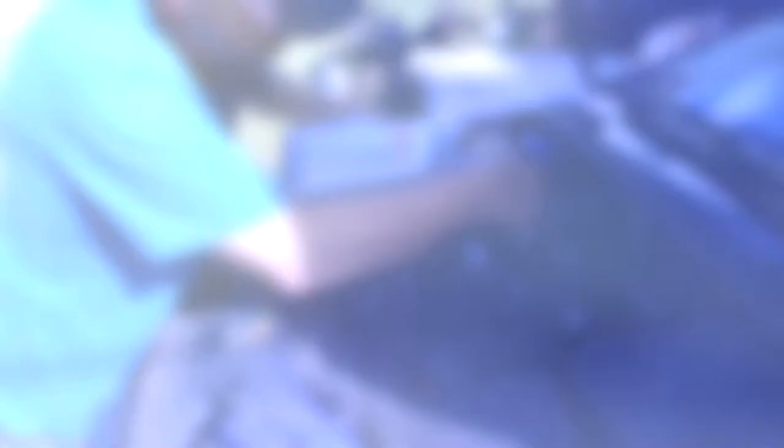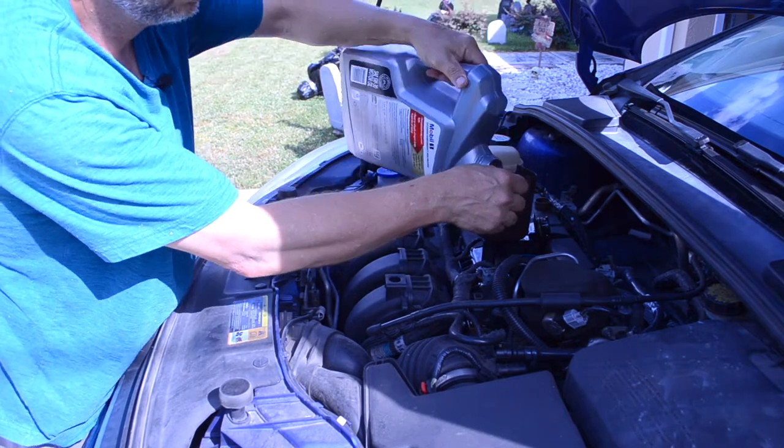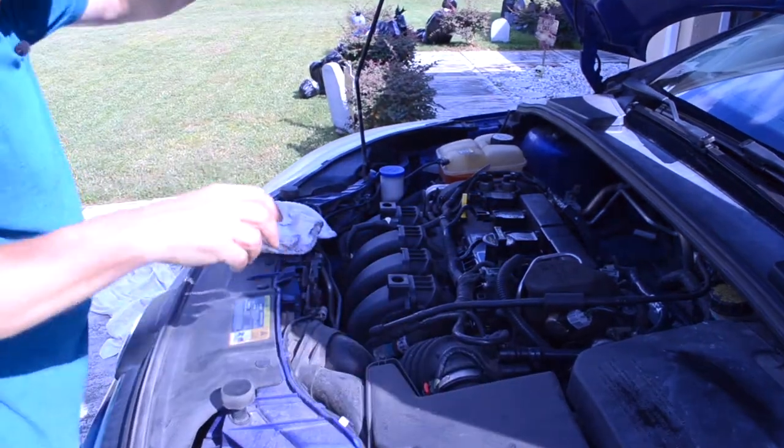The good thing about these five-quart containers is they have the marks on the side. Five quarts is up to here and I've already put that much oil in the filter, so I just need to go down to right here — that would be four and a half. I'm only going to put in a little bit right now to make sure I'm not leaking. Turn your bottle to the side like this — it'll actually pour better and it won't slosh everywhere. I now have a full quart of oil in the vehicle, so let's go down and check. I don't see any leaks at the filter or the drain plug — we're good to go. Now we can fill up.